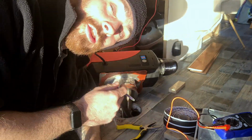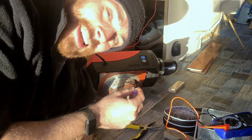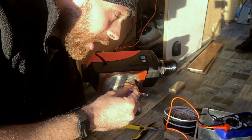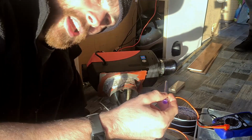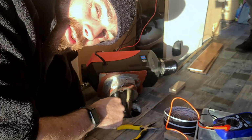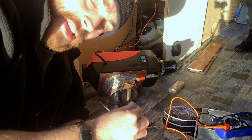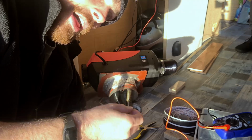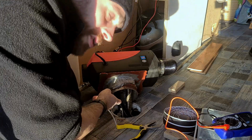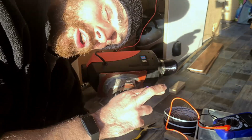Okay, so my first attempt at doing this didn't work because the fuel tube here got loads of air bubbles in it because we realised there was a leak in the old fuel tank. So I've changed the fuel tank. I've changed the way that the fuel is extracted from the tank, which should prevent leaks in the future. But because the fuel tube has got loads of air in it now, I need to get all that air out, including the little bits of fuel that are in the tank. So I need to draw all of that out and then put fuel in the new tank and then draw fuel all the way up so it's nice and close to this. And that, I'm hoping, fingers and toes and everything else crossed, should help.